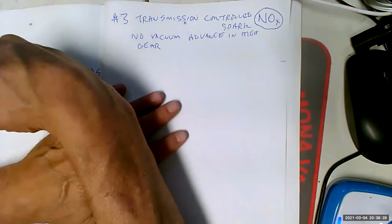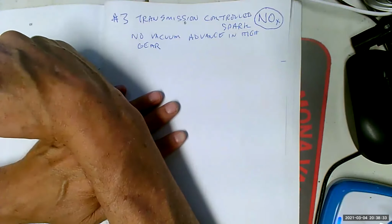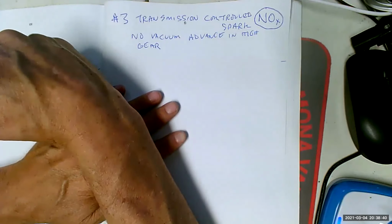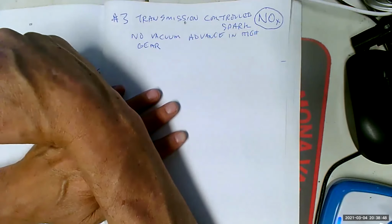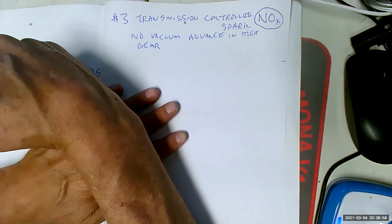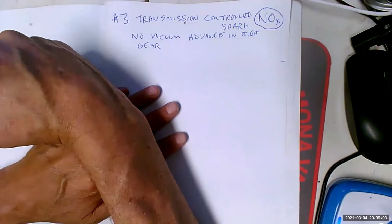All right, so people are angry about this because, first of all, they didn't understand how vacuum advance works anyway, but they could see that the whole point of vacuum advance is part throttle fuel economy. So as a result, you'd start losing gas mileage. This is when people started resenting emission control systems, because you would get worse performance and worse gas mileage, and the car would be harder to work on. And there's no OBD, so you actually had to figure out how all these systems worked, and you'd have to get professional service equipment. You couldn't just use the techniques you learned on Grandpappy's tractor.